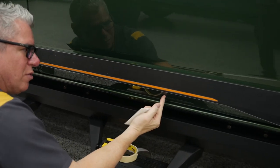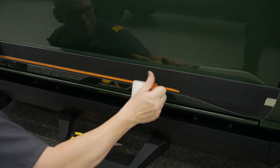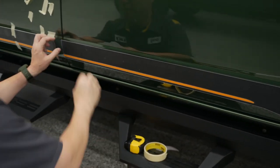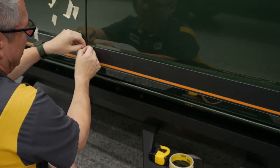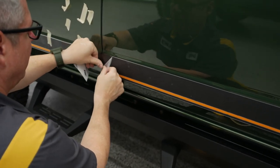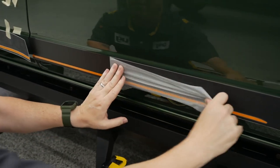And again, this is PPF, but that squeegee is right on that flat part, that 3-inch I mentioned earlier. So with that here, the squeegee is not touching this, and it's not touching this. It's just right on that stripe. So now, you're going to have to do a little picking to get that started off the back. And then just like we talked about on the hood, that 180 degree angle, you don't want to pull out. You're going to take it right off the door or right against itself.